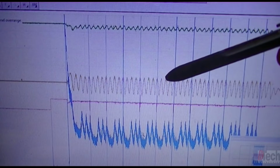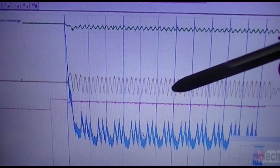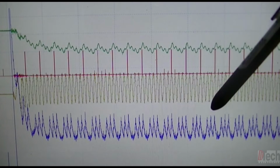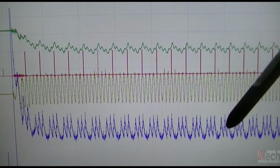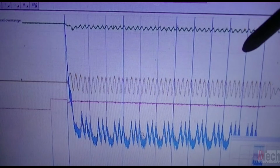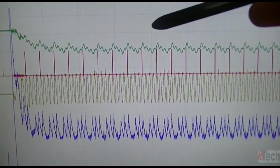This is a bad exhaust valve in cylinder number 3 of a 4-cylinder engine. This here is an actual saved scope capture of that second vehicle that I showed you with a, again, burned exhaust valve. Think about that and look at both of these. Mainly here. See that?